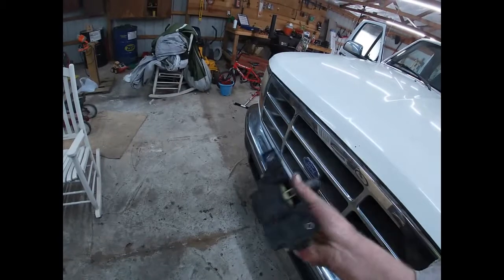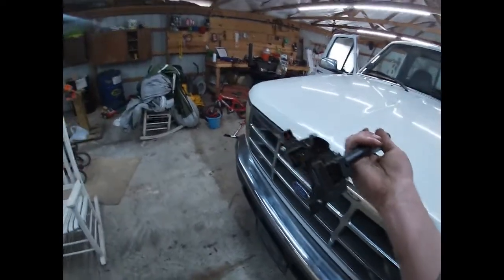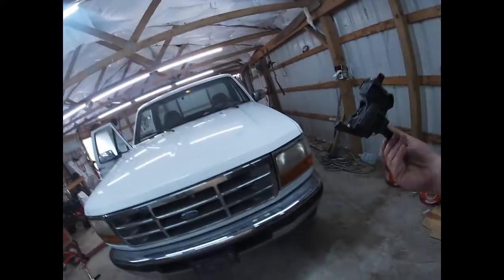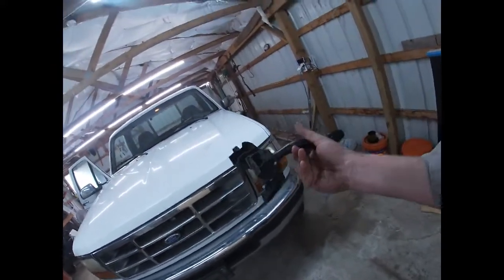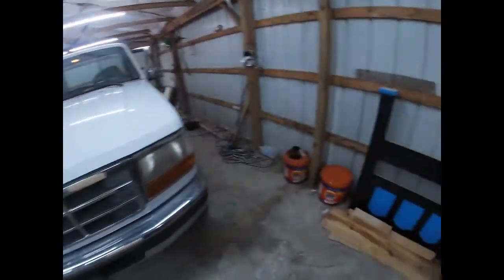So anyway, it had multiple problems, and then finally the contact for the left turn signal failed. Turn signals and wipers will drive you nuts as far as electrical diagnosis is concerned, guys. Neither system works like you would expect it to. The turn signals, brake lights, and hazard lights are all basically using the same wire, but then only having brake lights on the back, and it doesn't turn on the fronts when you step on the brakes and all that good stuff. Yeah, it gets a little complicated. And then wipers, I can't even begin to describe how that works. Basically, you just change parts until it works. There are ways to diagnose and what have you, but again, complex wiring, even on the very old stuff, unless of course you're fortunate enough to have air or vacuum wipers. And I don't really know that that's fortunate or not.